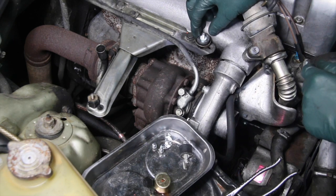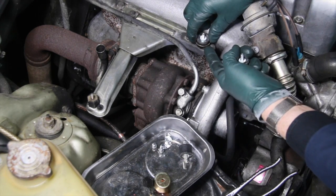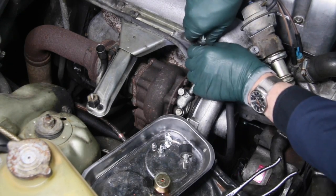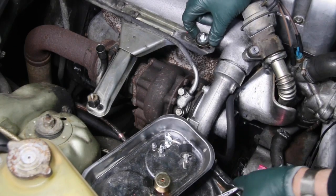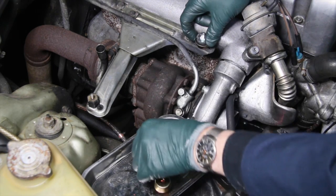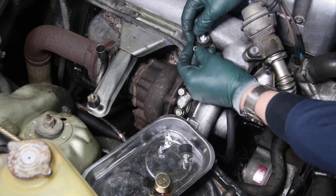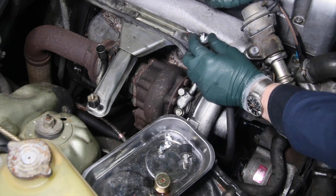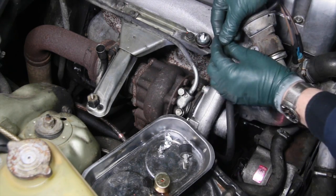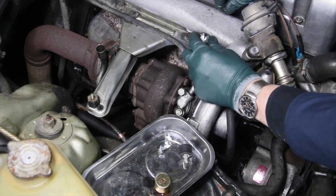When you're using the heat shields, you can't get a hold of the base of the rubber mount, and it's not going to help to get the pliers on the heat shield. So what you want to do is tighten it down by hand as tight as you can, okay? And then just come up here at the top and give it a little tweak. Now I will take one of the locking nuts. I think you can see why this is so important if you're using heat shields, that you definitely use a locking nut, because it's really hard to tighten the rubber mounts securely onto the bracket. Now I will get underneath here, I'll install that locking nut and tighten that down, and then I won't have any problem in the future with this thing starting to loosen up at all.